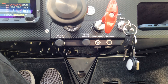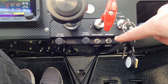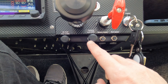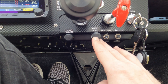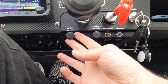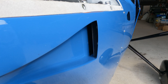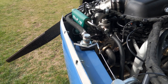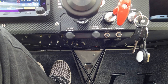Underneath the throttle and brake controls are fuses for both the battery master and start power, and a heating switch. This aircraft has cabin heating — pull out to open the heater and it is absolutely ferocious, so you have to be quite judicious with its use, but in winter I'm really grateful to have it. The other control is the oil flap, which closes a flap on the outside cowling allowing the oil to heat up more quickly. You must remember to push that in before takeoff to ensure the oil doesn't overheat — and that's included in my checklists.